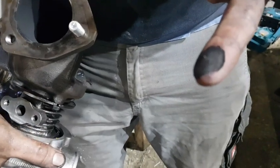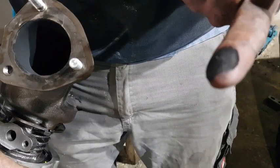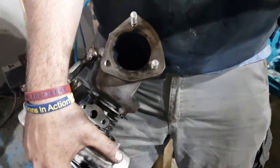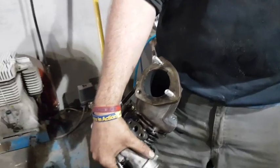We can see that there's thick soot coming in there, which suggests to me that the fuel hasn't been burning correctly inside the cylinders. So as it's come out of the exhaust, it's massively sooted the exhaust up. Yeah. And over 3 miles, I wouldn't expect that level of soot. There you go. So anyway, that's it. We just wanted to log this.